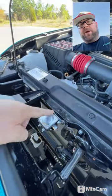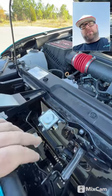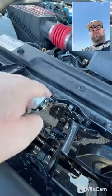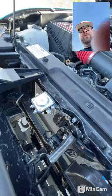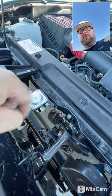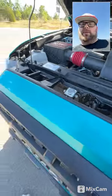We've already pre-wired it for a winch source here — the power outlet for the winch. We've already pre-wired that, so all we have to do to install the winch is run a ground and then our hot is right here for the winch. We like running the power this way — you've seen it several times on these wireless winches. Just because it's wireless, you still have to reach down and hit that power switch. So we leave the power switch on the winch on and we kill power through the solenoid through a switch inside the vehicle, so you're 100% wireless at that point.